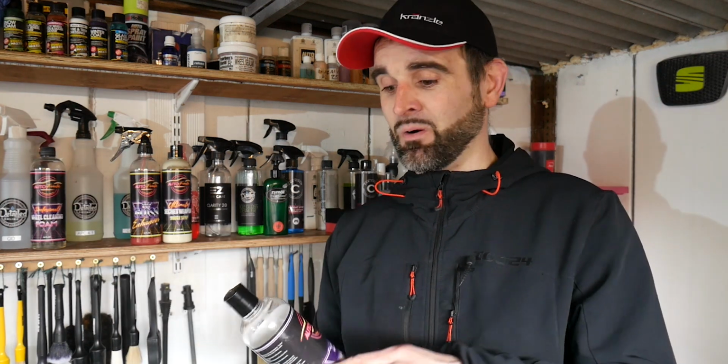It is just like putting any other shampoo. You know, it could be any other brand through a snow foam lance, and that's what you're going to get. So you've got 2 options really. You can apply about 50 ml, 60 ml, which is also around 2 ounces, into a bucket of about 15-20 litres, which is what I did, or apply it through a snow foam lance and then wash the car with it already on there, which again, is how I understand a lot of people in the States do wash the car. As I say, a lot of them seem to use a hose pipe as opposed to a pressure washer, and they'll apply products such as this through a foam cannon and then leave that on and wash it that way, using a bucket just to rinse them in between.